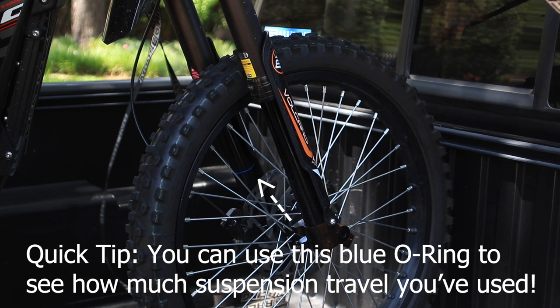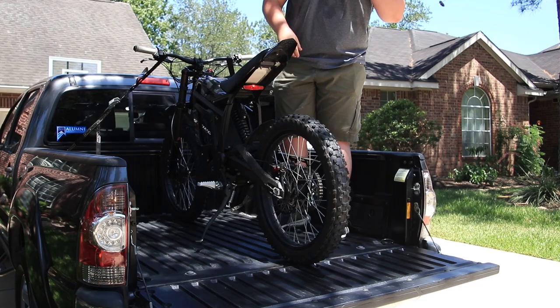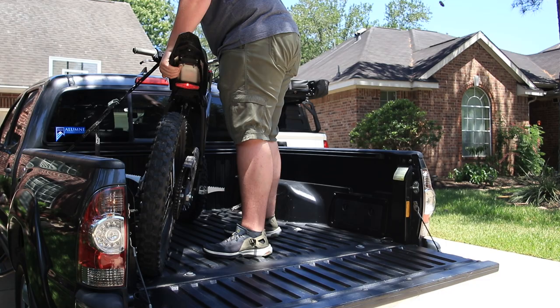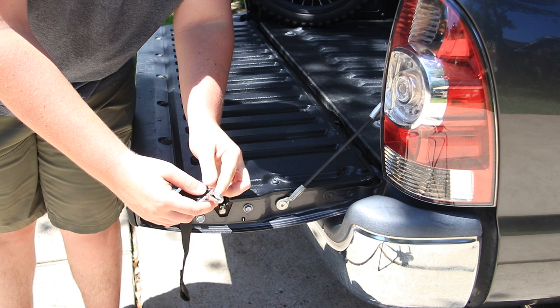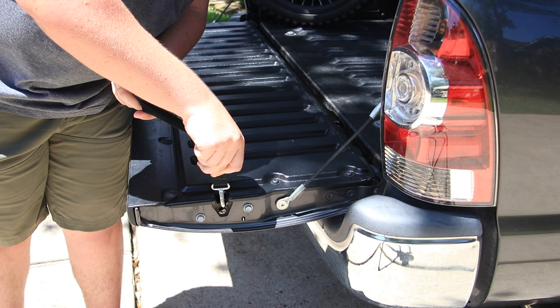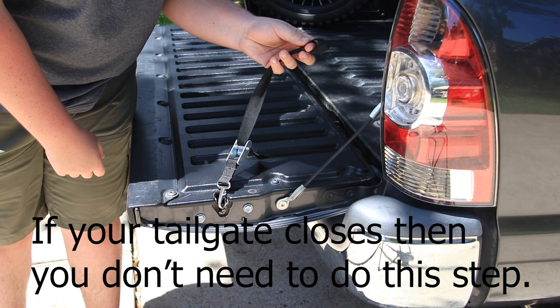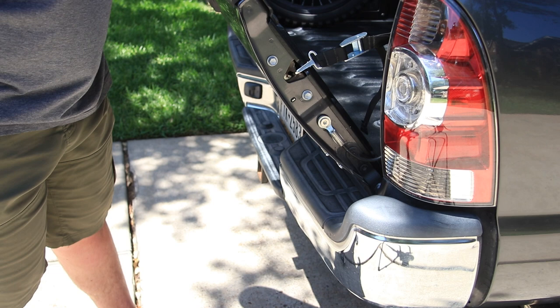Check that the forks aren't compressed too much — that's what you're looking for. The last thing to do is close up the tailgate. Grab the subframe of your bike, lift that back wheel up, and move it over to the side. Then take a small strap that has a hook at one end and a loop or hook at the other. Take the hook and latch it into the tailgate itself, then take the loop and attach it to the bed. Tighten up the strap as much as you can — this will keep the tailgate up so it's not flopping around.